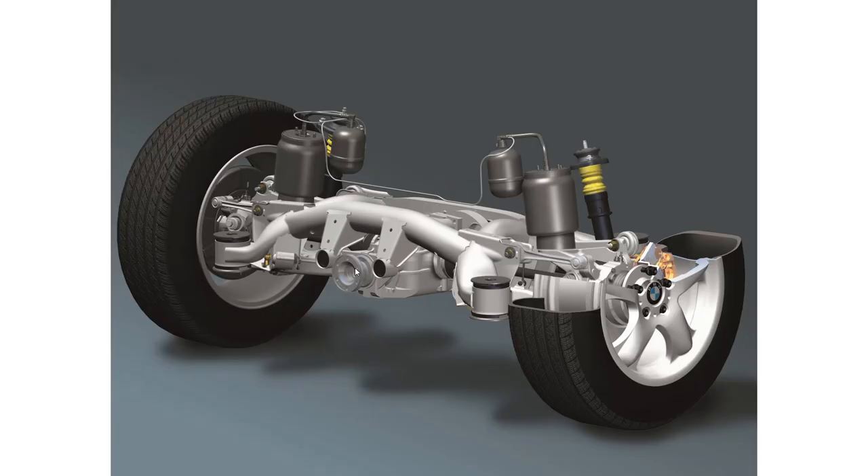Why is that important? If we look at this BMW factory air suspension system on the back of an X5, we can see something interesting. Here are the two air springs, but we've also got these extra volumes connected to each of the air springs. These little tanks are called accumulators, and they increase the amount of air available to the air spring. The pressure inside the accumulator is the same as the pressure inside the air spring — the two are interconnected with a pipe. As the air spring moves through its stroke, air can flow in and out of that extra volume as well, softening the spring rate over what would have been achieved with just those springs by themselves.